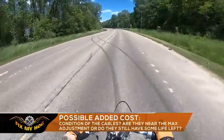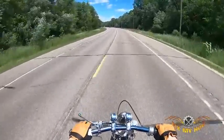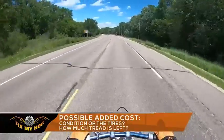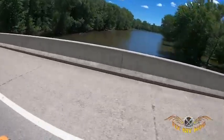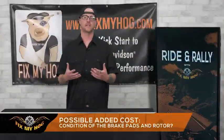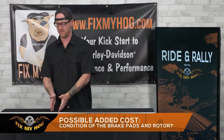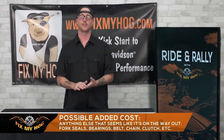Before getting into buying an old Harley-Davidson, be honest with yourself — old bikes take a lot of maintenance and a lot of time. I have to lube my chain every 300 miles and check the oil every 2,000 miles, replace it, clean the oil tap screens. The older bikes definitely take time; they're not necessarily difficult to work on if you have a good service manual, but they take time and tools. Shovelheads are notorious for leaking, so you have to be prepared for that. Research the engine's common problems and ask yourself if you have time to address them to ride safely. If you're looking at getting into the vintage market, I'd absolutely suggest it — I'm loving it — but it definitely has some unique challenges. Until next time, ride safe and we'll see you on the road.